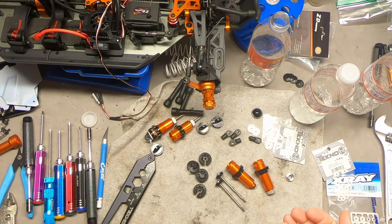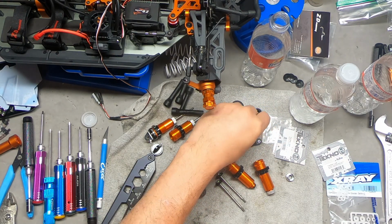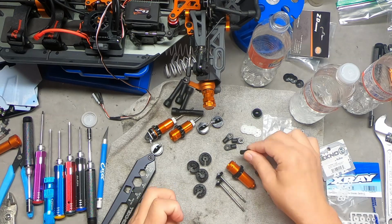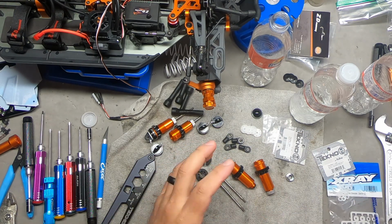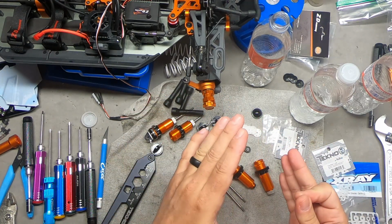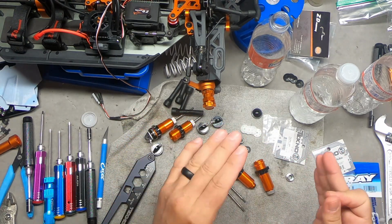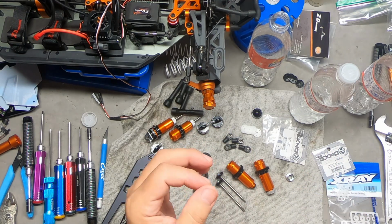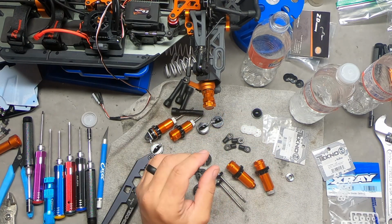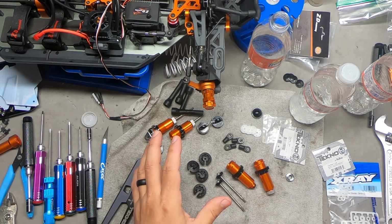So I went with something with slightly smaller holes than the pistons I was looking at earlier, the ones that I already had for a different vehicle, and that's because I want to have more pack. Smaller holes will give more pack. Pack is the faster the piston is compressed, at some point it hits a level, and it's kind of a combination of the holes and the thickness or viscosity of the shock fluid where it almost stops or it dramatically slows down, and that's what you're looking for under certain kinds of conditions.